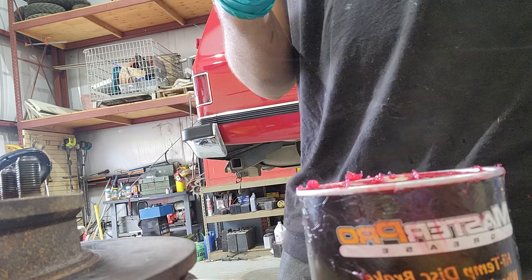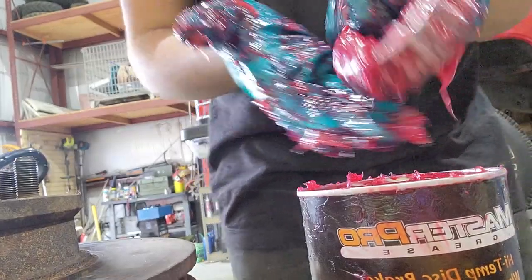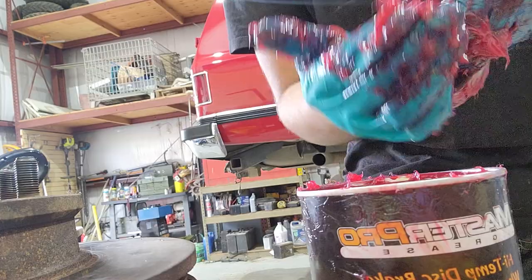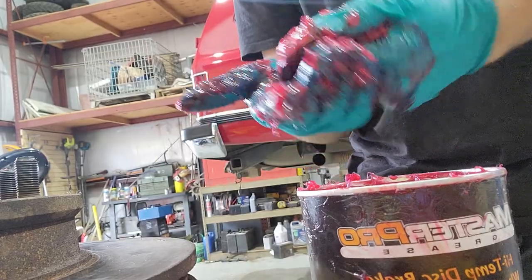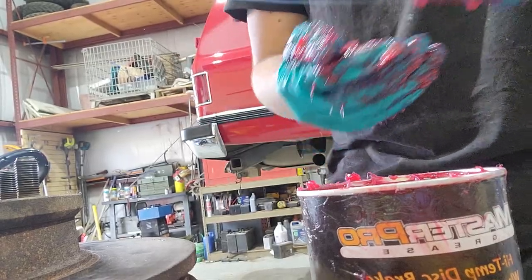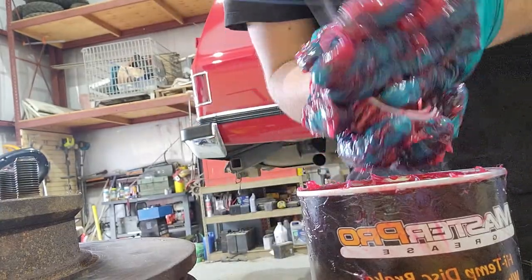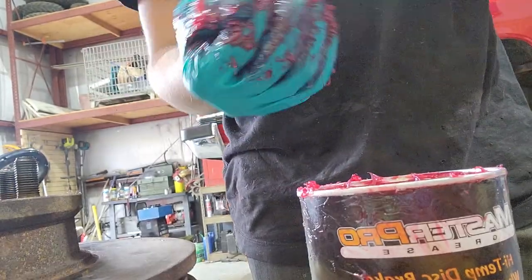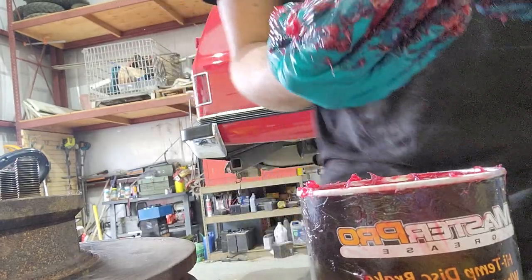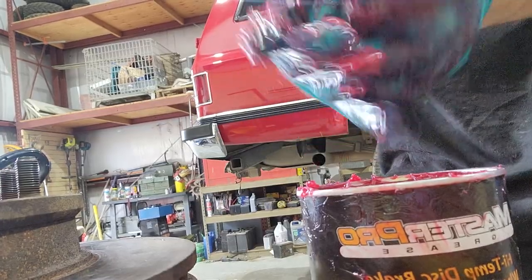Okay. More inside. Now I got grease on there again. Try to slap it off, and then once again, it's like a press and roll into your palm. You just gotta really make sure these are packed with grease, that all the rollers are gonna be thoroughly happy with their quantity. So roll, roll, pull the grease out, scrape it back. It's just this almost monotonous process here. Now I'm gonna press it all in.